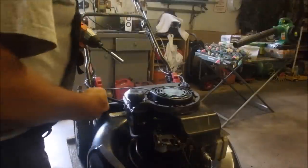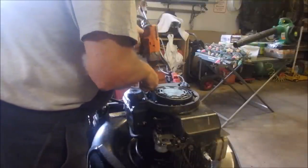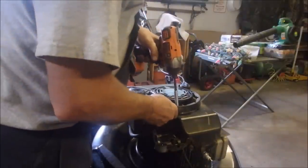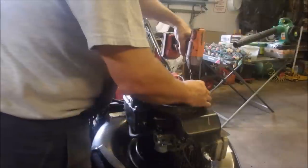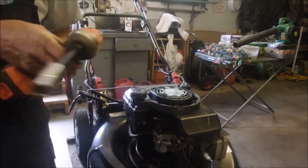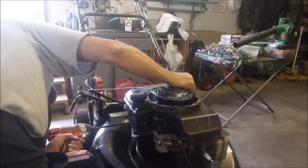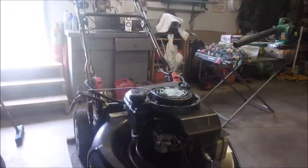Good. All right, I'm just going to attach the tank down. There's three bolts. I loosened the big 3/8 one that holds the tank on the pivot, just to get this out of the way. And then we'll go back down and re-tighten the pivot. I'll show you what I mean. Good. Kind of torqued it a little bit. And then you guys might notice, but I changed this to a longer shaft. Now I can just reach in and redo this tank bolt. Good. Doesn't sit perfectly there, but...